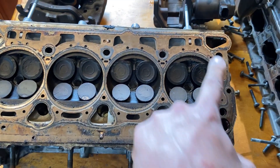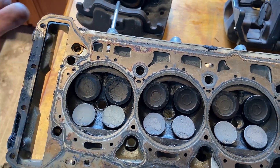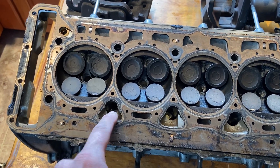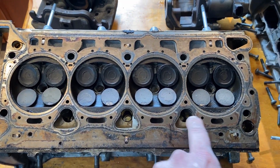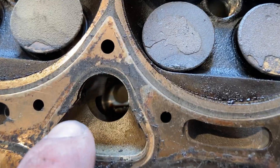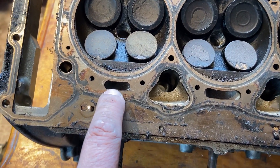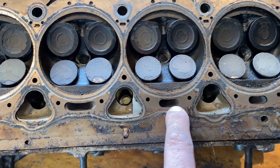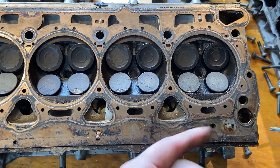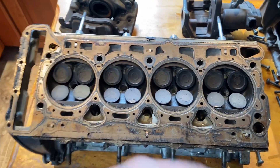This is where the oil pressure pushes. The pressure pushes through here and it goes through oil galleys inside the head. The oil coming out of these bolt hole areas where the cylinder head bolts would be — the oil is going to return back because these bolt holes are extra big and there are holes down there in the sides. These ports right here in between are where the coolant comes through.